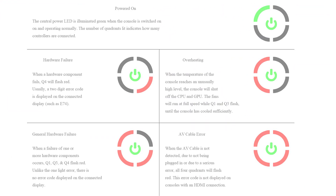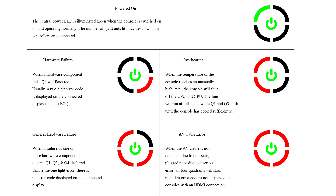We can see here how different red light combinations indicated what the specific error was, with a failure of a single component indicated by one red light, and multiple hardware failures indicated with three lights. These were most likely caused by components coming loose from the motherboard after the brittle solder cracked. Two lights would indicate the system overheated, caused most likely by the previously mentioned inadequate cooling system.